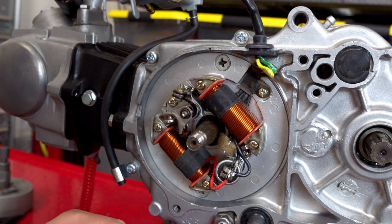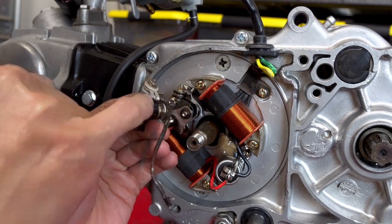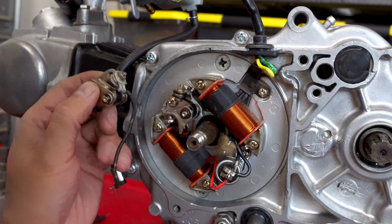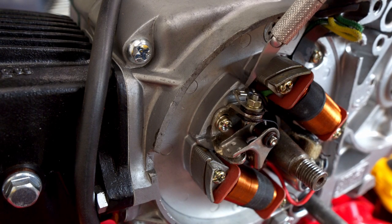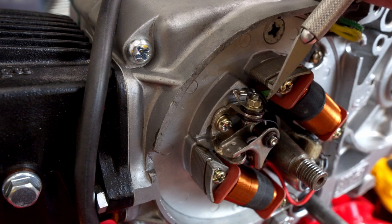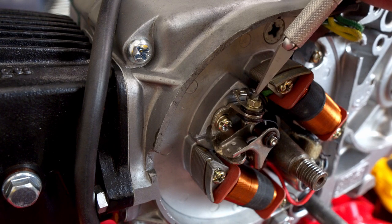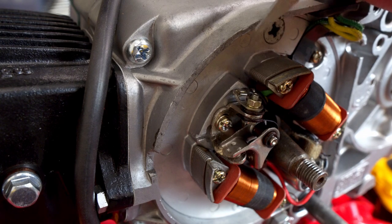It was particularly perplexing because it was the same case on the second set too. The reason ended up being really stupid. This set of points, which came off the engine in unknown condition — the line was connected underneath the little insulator. It should have been on top. So it was always staying grounded and in that situation it's never going to work. The other set I assembled myself and had confidence in was on the correct side of the insulator, but if you look closely there's a tab — which I've since bent up — that was flush and pointed inward, actually grounding out against the frame of the stator plate. That was causing a constant short circuit for the condenser. So I had two sets of points and both were wrong in slightly different ways.